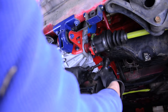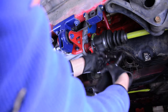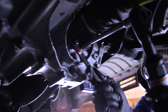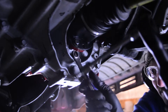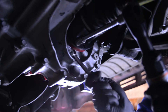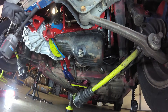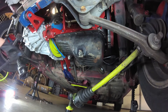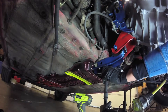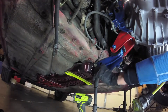After you take the exhaust off, we're going to move on to the axles. The passenger side axle still has the studs in it, so you just zing them off. Just loosen it, take it off, and push it out away from the transmission. Moving on to the driver's side axle — this one is going to be in the way, but you can weasel the transmission out without taking it out of the hub. After both axles are removed, go ahead and move to the front and rear transmission mounts. There's a splash seal that's gone on most MR2s by now, but this one still had it.